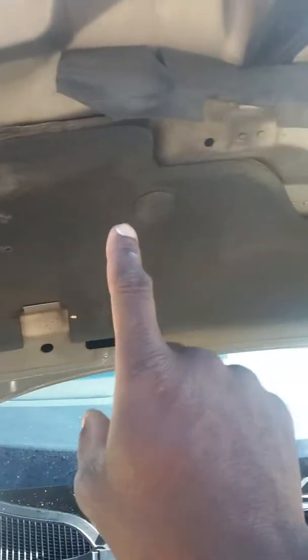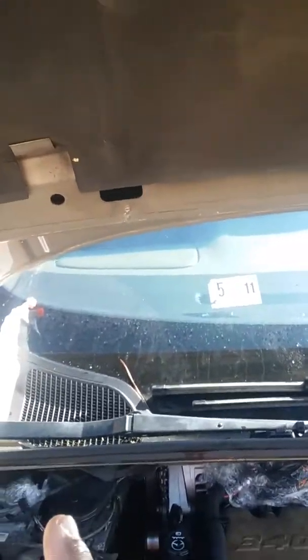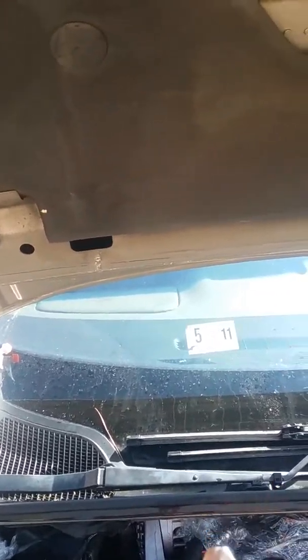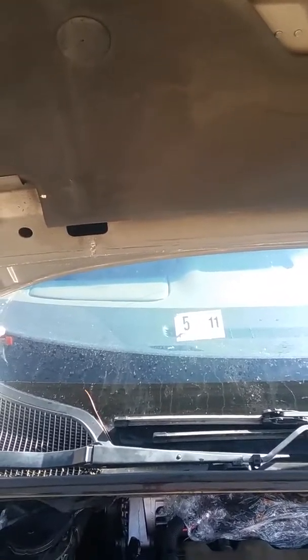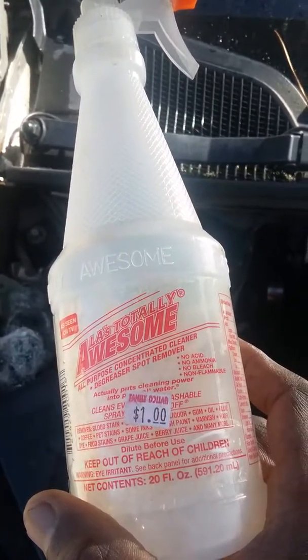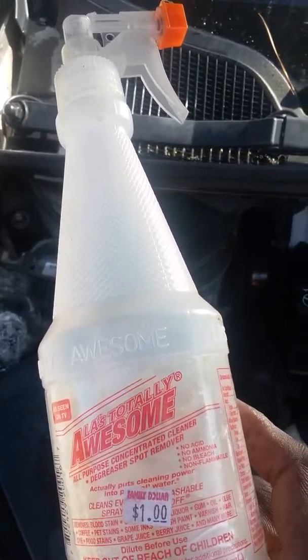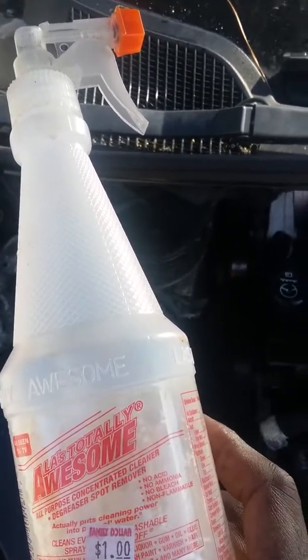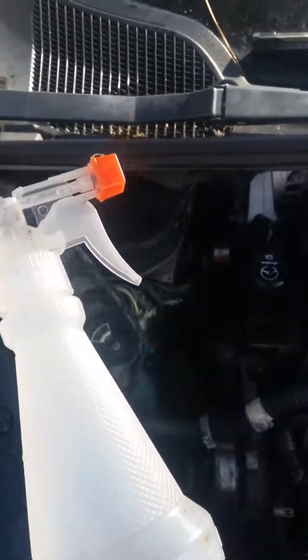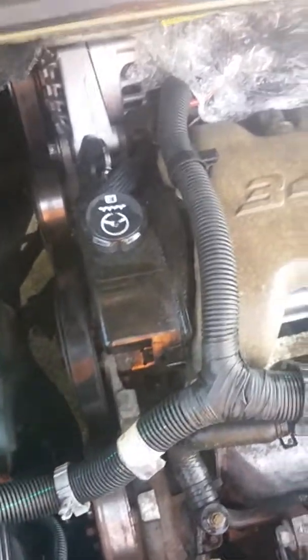Never, ever wash this with a pressure washer. This would be soapy water if I did do it, and then later on wipe it off with Lysol wipes. The stuff that I sprayed is some cheap stuff called Awesome — it is awesome. The dollar stuff is better for an engine than using something corrosive like Grease Lightning. With the degreaser, it's best to dilute it 50-50. And then if you have a problem cleaning a particular area, I loosen up the grime and go back over just that one section — no use going back and doing the whole engine.